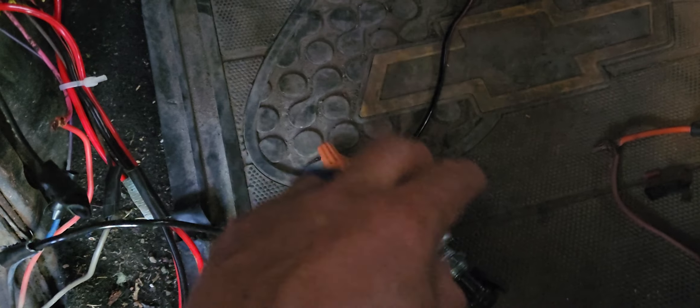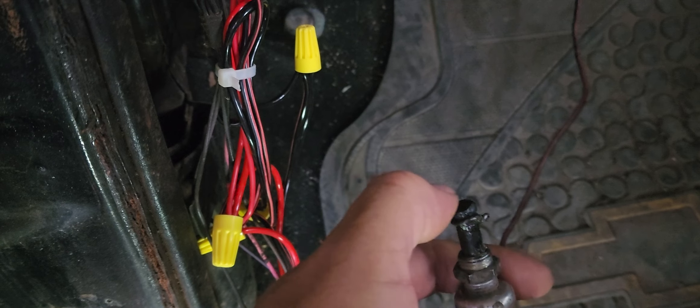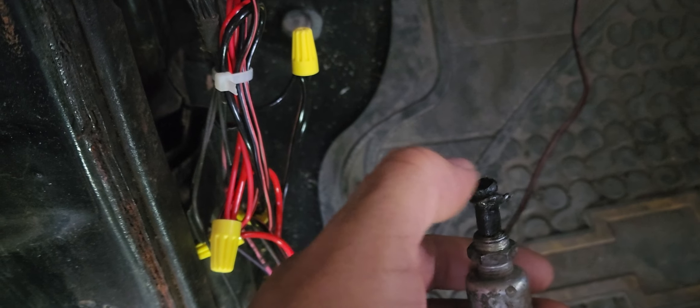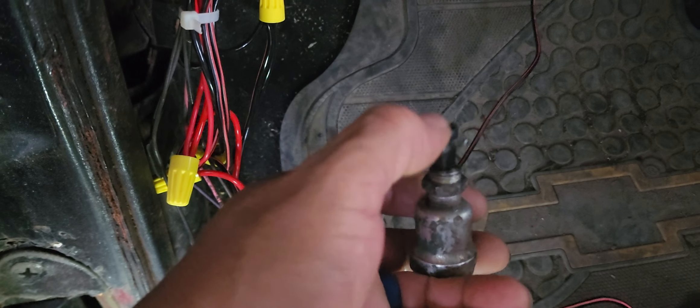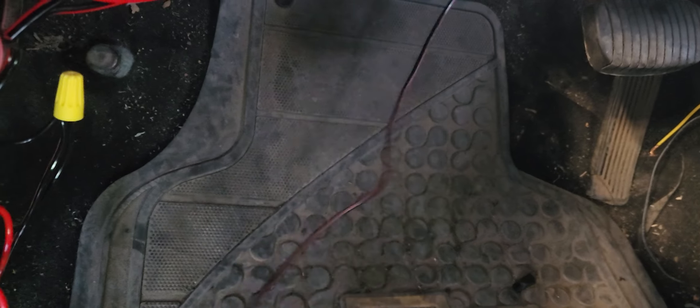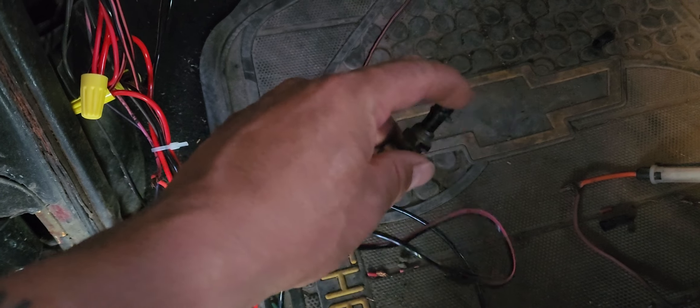I've got the old switch here. I added a little bit of grease there, but look — if you push it kind of hard it gets a bit stuck. I try not to go all the way down. I'm gonna have to get another one exactly like this and get the original. The wires right there — I'm trying to get these two wires connected: one is a hot wire close to the battery, and the other one is for the lights. One in and one out — it's a simple on/off switch, that's all it is.